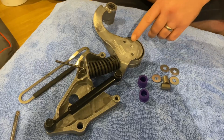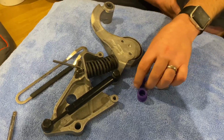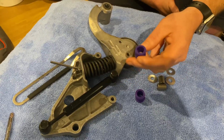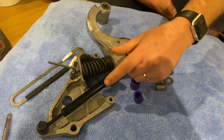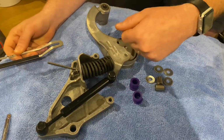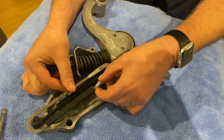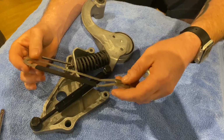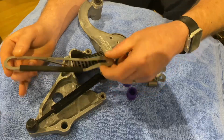So we're going to be doing a separate video on how to change the belt tensioner, which we'll link in the description box below. Before we put it on the car, we're going to be upgrading the original bushes, as they can perish over time, to these Powerflex ones. What can also happen is the damper can end up losing pressure, and if it does end up failing, the tensioner can end up swinging down into your crank pulley. So this tensioner stop just goes on the two bolts and stops that from happening. It was about 25 quid from Low Mini, 30 quid with P&P I think it was. So I'm going to show you how to do that now.